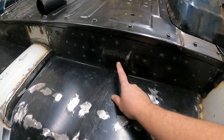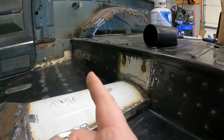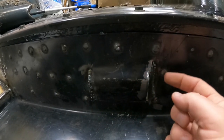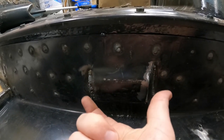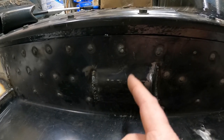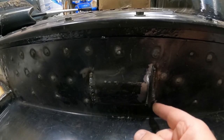The biggest concern for today is getting these covers sorted out. Where we left off, I had welded them up and it looks really ugly - not symmetrical, not clean, ugly as homemade sin. So I had a thought: I measured it out - it's three inches tall, about five inches long worth of coverage needed, and only has to cover about a half inch worth of depth. I can make something that'll literally just go over top of this, weld up the outside seam, and we're done. So I'm just going to cut all this back out and clean it up.